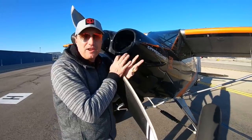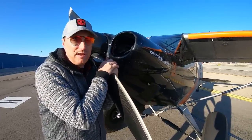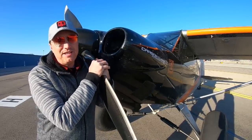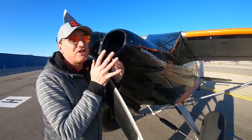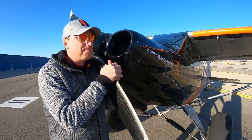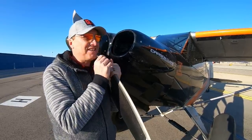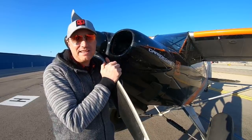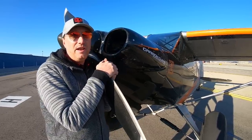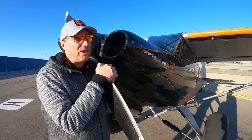As far as the motor goes, I've got the standard CC340 motor that Cub Crafters puts in their EX line — everything up through the EX3 or FX3 uses this motor. On paper it's rated at 180 horsepower, and I agree — it's a really good motor. When I first bought my airplane I flew it to California to a company called Lycon and had a port-and-polish and balance done on the motor. It makes it run really smooth. I fly with a lot of other guys who have the same setup, and mine does tend to operate a little smoother.